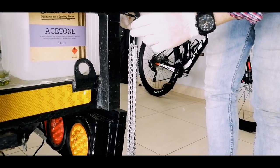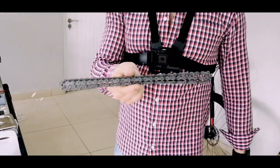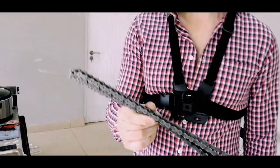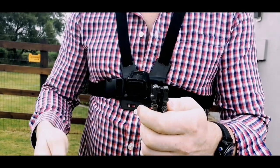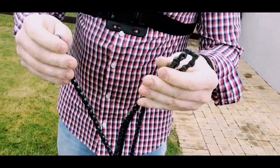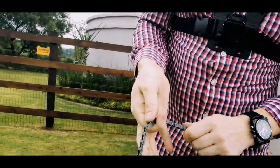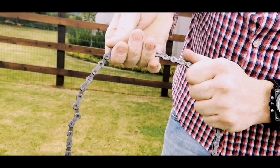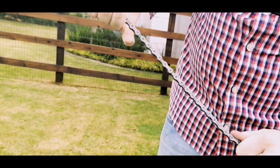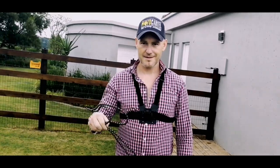We'll take the wax chain, hang it up to dry for about 10 minutes. Once it's dry you'll see a very stiffened chain. Now the moment of truth — when your chain looks like this, it's properly waxed, nice and stiff. What we do now is articulate the links — we just crack them to loosen them up and get rid of the excess. I straighten the chain and drag it over my finger to crack the links and loosen them up. That stiffness disappears — now you've got a pliable chain that bends. This chain is waxed and ready to go.